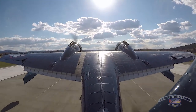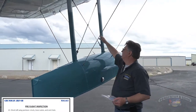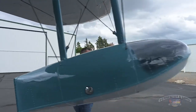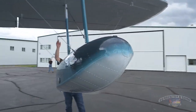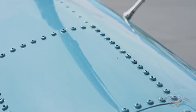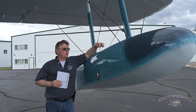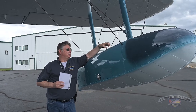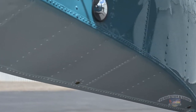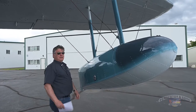I'm going to work my way out to each of the pontoons and make sure all these wires are tight. If they're not tight, we'd be suspicious that something in the wing has bent or changed, so this geometry should stay consistent. On top of the float is a little vent hole that has to be clear — if you climb with it blocked, you'll build pressure inside the float and could damage it. There are also three plugs in this float. I give it a shake to make sure things are solid.